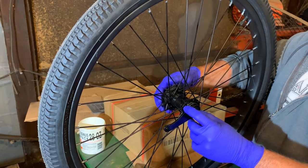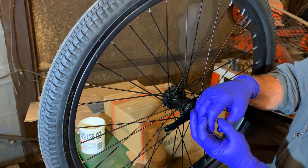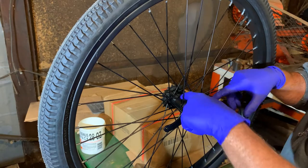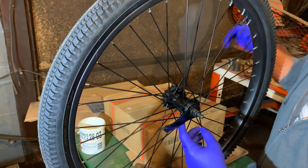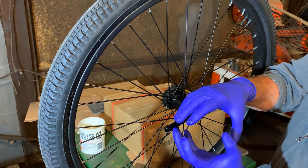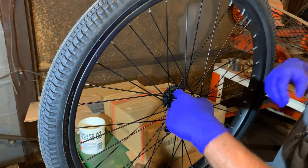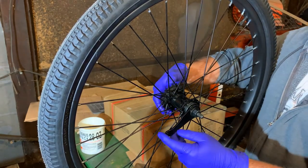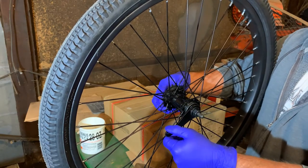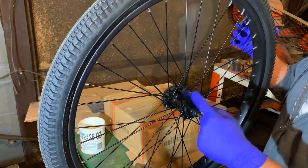When you pedal backwards, it's on a corkscrew actuator, which is basically just a giant screw. The brake shoes are two half-moons of steel, and when you pedal backwards it rides up the threads and opens up, putting pressure on the hub — your hub is actually your brake drum. So you're riding down the street, time to stop, you pedal backwards, the shoes open up, and there you have it. Then you pedal forward, the shoes come back together, release from the hub, and you're back riding. That's just the general operation of the coaster brake.